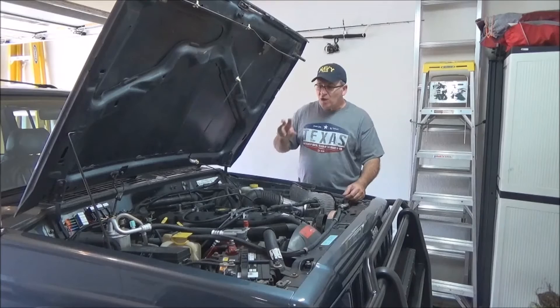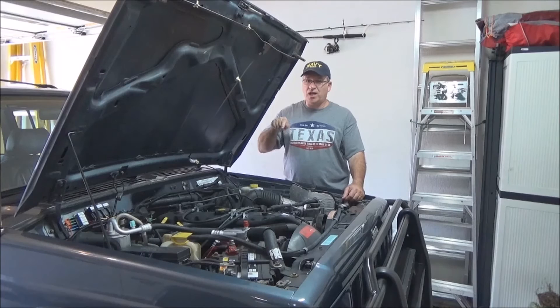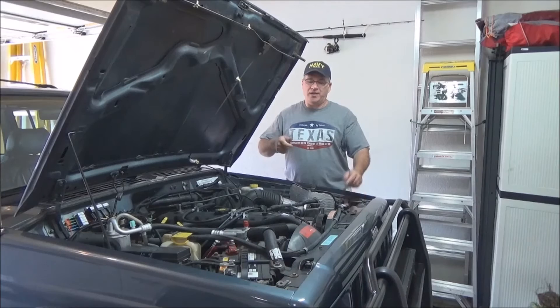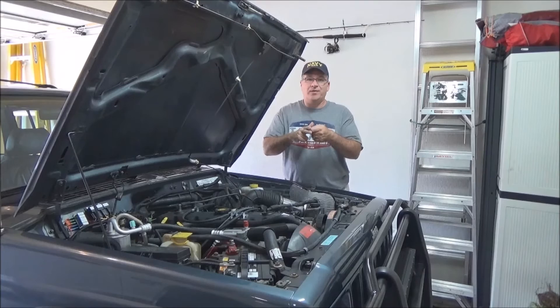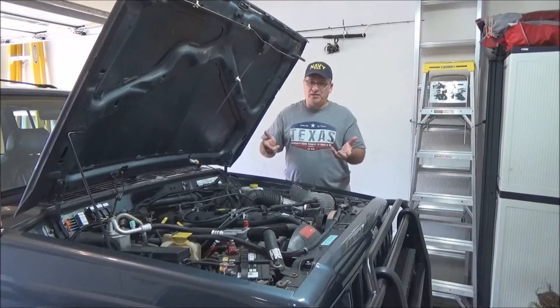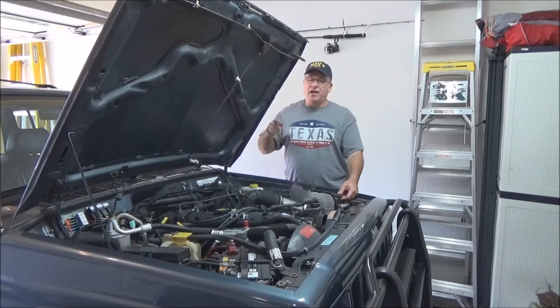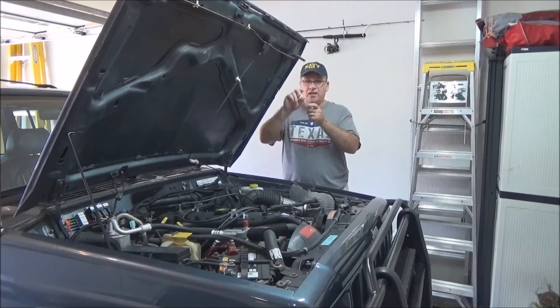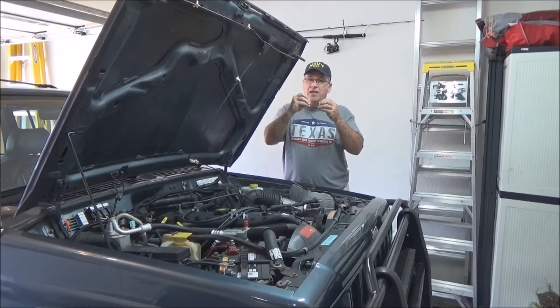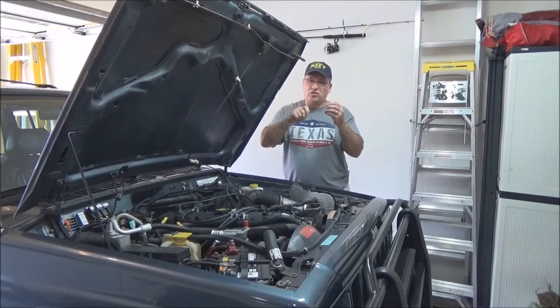Here's the tricky part — you cannot use the parking brake cables from your XJ on the disc brake conversion. Some guys online wrap the XJ cable end around and put a cable clamp on it. Don't do that — it looks like crap, it's going to get bound up and rust. Toss your cables. Getting those cables out is kind of a pain because they have the little finger spline thing that locks them in. Take a small hose clamp with you, put it on the inside, screw it down tight — that'll squeeze the clamp together so you can pull it out past the pins without breaking them.